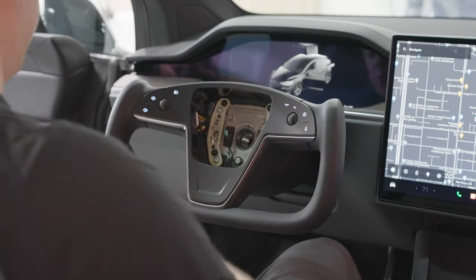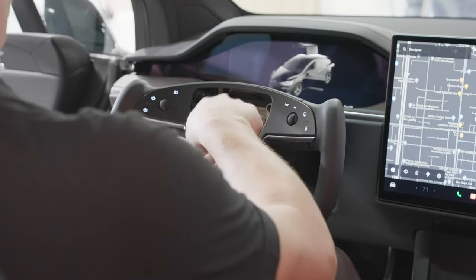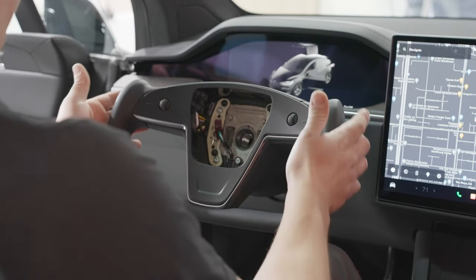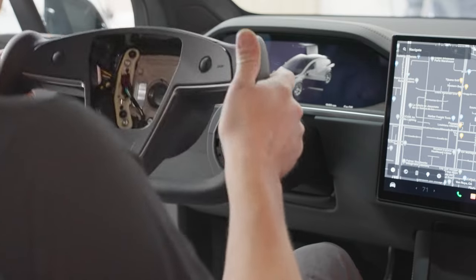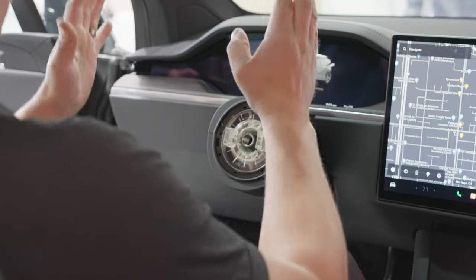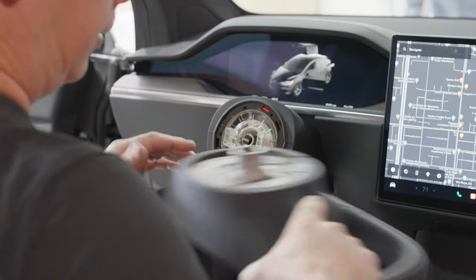It will only go on one way, but it just helps you to orientate it the correct way. Then do the same thing with the brown plug as you just did with the yellow plug. Undo it — you'll notice all the lights will go out — and then to remove the wheel give it a little wiggle side to side and it pops off. Don't touch the clear controller at the back because this will mess with which way the steering wheel thinks it is for the autopilot and stuff like that.